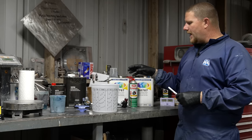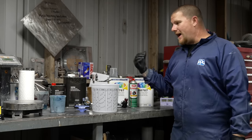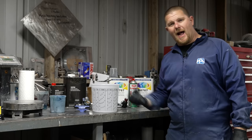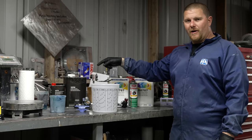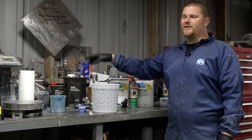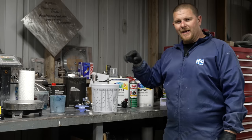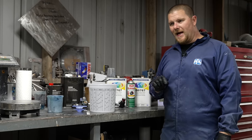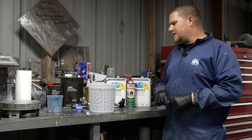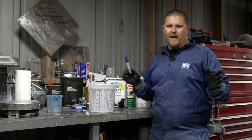When you go and you try to put clear coat over base coat that's not fully dry, that reducer for that base coat still has to exit. So if you start hitting it with clear that has a hardener, it's gonna harden faster than all of your base coats and primers do. And when it does that, it's going to exit through the clear and it's gonna make it look like tiny little pinholes. That's solvent pop too. There's different variations of things that can happen. I found all of these things out the hard way.